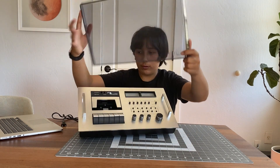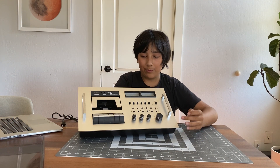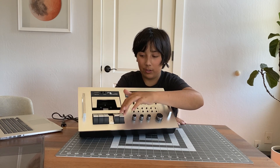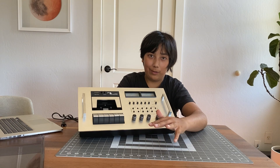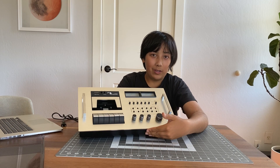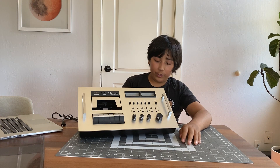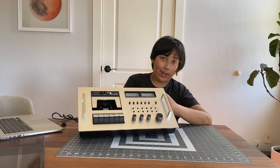With this deck, I'm going to take the dust cover off, but it has a few little problems. The first problem is this pause button doesn't work — even if you press play, the pause button just won't work. It does play, but it's a little inconsistent. Sometimes the pinch roller will get a little sticky and the tape will end up getting eaten. That hasn't happened to me in a while, but just to be safe I'll make sure to clean everything. I'm pretty sure you just need to undo screws on the bottom and then a few screws on the back to get this back plate off.